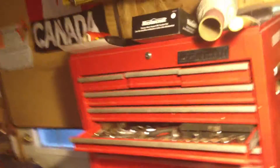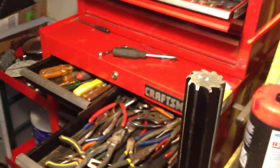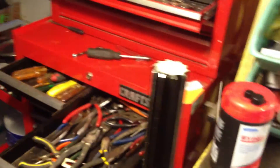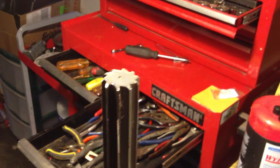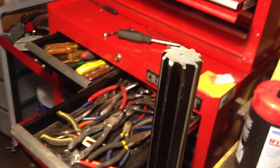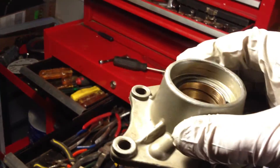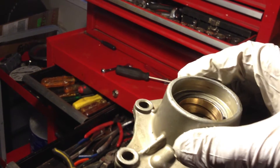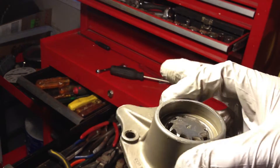Once the reamer is in position, I just held it in the vise — since I don't have a milling machine here. I just use a little lubricant, a super lube, it works just as well. You just want a little bit of lubricant on it, because these are bronze bushings, they are not brass. When you use the unit, you're going to take your end cover with the new bronze bushing, fit it on — it'll just go because it's tight — and you start turning it, and you're going to get the chips.